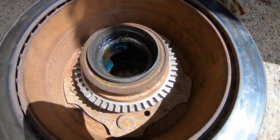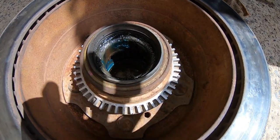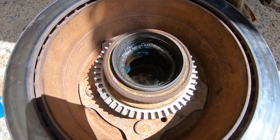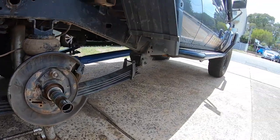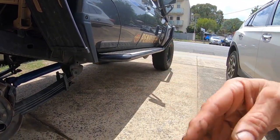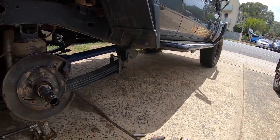I've had a couple of blokes ask me over the years about shuddering brake pedals. I've always told them to check their bearings, because with the fronts when the bearings come loose it wobbles, and when coming down to low speed it will shudder the brake.